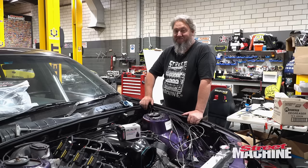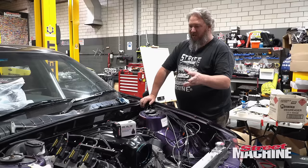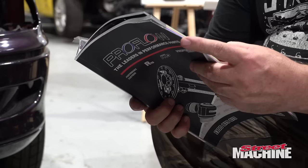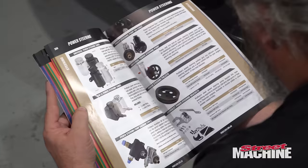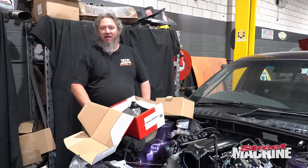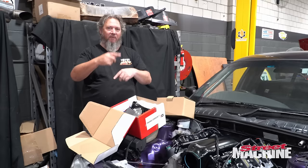I need to work out some of the architecture at the front here. We've got an electric water pump, we've got an alternator. What I don't have is a power steering pump — I need to work that out so we can work out its position, and then work out where we need to have our regulator. I have consulted the catalogue, the internet, and the tablets brought down from the mountains. We've got a power steering pump on order. Still haven't sorted out all the pulleys on the front yet, because the electric water pump is changing a lot of that stuff — normally there's belt wrap around the water pump and all that sort of stuff. I have ideas. We'll see if they work — more on that later.